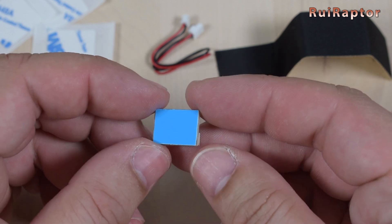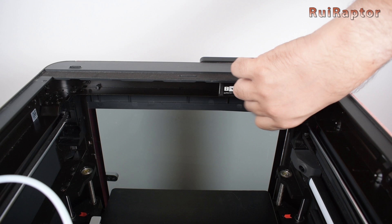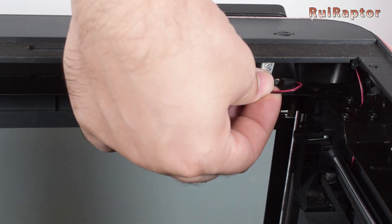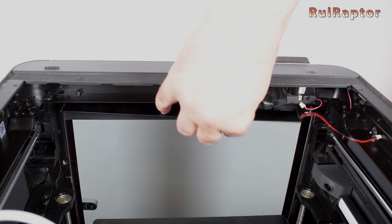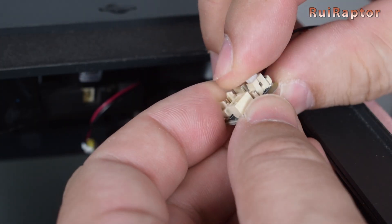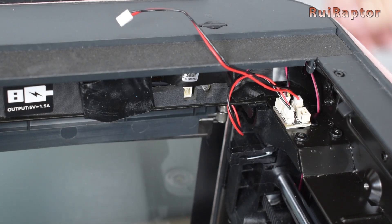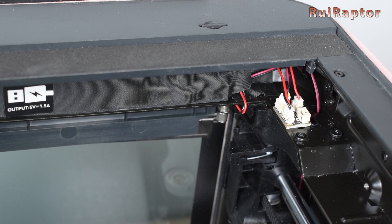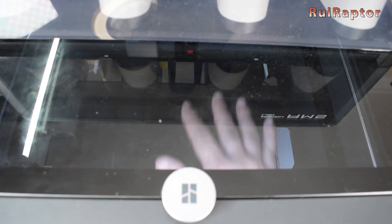This board will be used if we want to keep the old and the new light connected together. The installation is very simple. First, we need to locate the stock light connection, which is on a board behind the display — the cable with the black and red wires goes to the stock light, so we need to disconnect it. The new light is placed under the metal frame and, since there are magnets, it will get stuck under there. On the small board, we connect the extension cable, the stock light cable, and the new light cable. The board can then be glued to the top metal frame. Next, we connect the extension cable to the board behind the display. All we need to do is arrange all the wires and we're done. The difference between the stock light and the new light is huge — the new light covers the entire printing area and more.